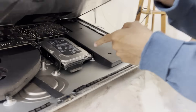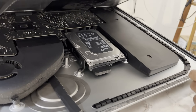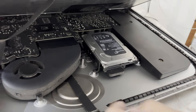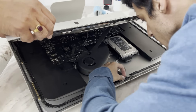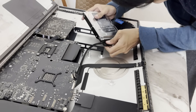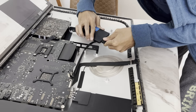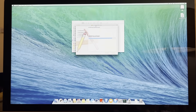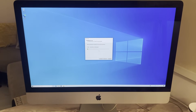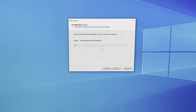With the help of my dad, I managed to get into the device and remove the two ribbon cables to disconnect the 1440p display. Yeah, this thing had some really nice specs for the time. Getting rid of the speaker system, and then it was just as easy as swapping the old hard drive with the new SATA SSD. Giving it a quick install of macOS, I used Bootcamp Utility to install a fresh copy of Windows 10.